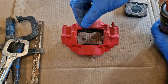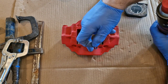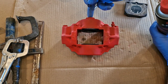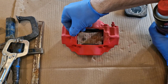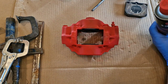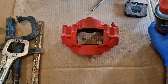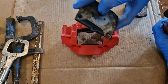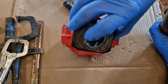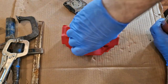I think these two extra pieces might be internal seals, because I know the two chambers are connected through the brake feed — there's probably a channel each side and these seals are probably where you'd split it. I'm obviously not splitting these, so I'm going to put them to one side and keep them just in case. Here's our pad — I'm recycling the old anti-squeak plates from the back of the previous ones, though I'm missing one so I'll have to get creative there.